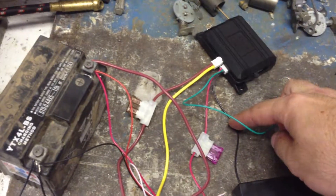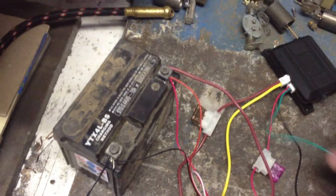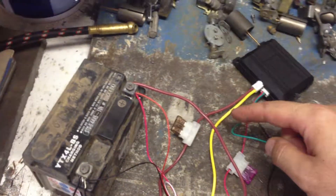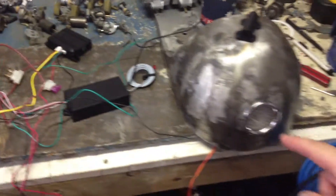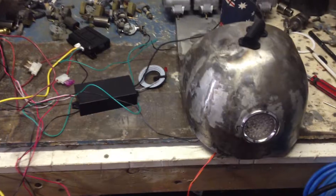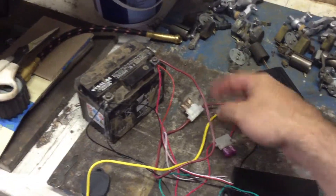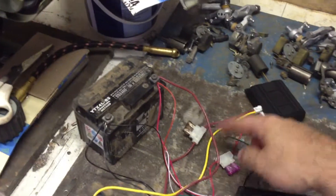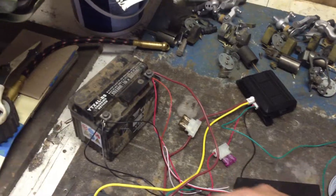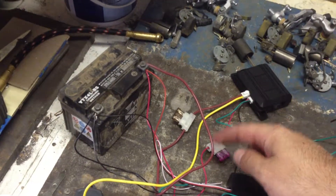Black is again simply the negative, red is the positive, sent over to the battery. This is the bit I buggered up: if you've got a positive feed — which for this test setup I'm just trying to light a light up, but when I wire it into the bike the ignition is a positive feed anyway — you have to have the positive coming in on the brown lead with the fuse and then out on the yellow. If you flip it around and you're switching a negative feed, then you'd have it on the yellow and the output would be the brown.